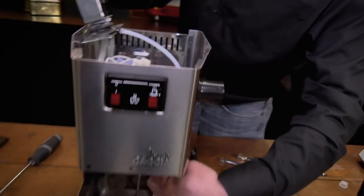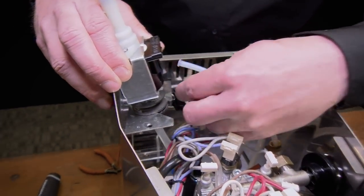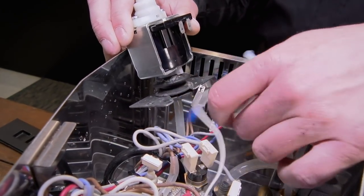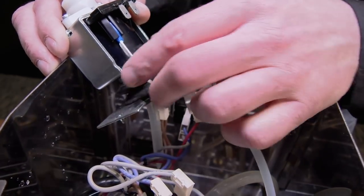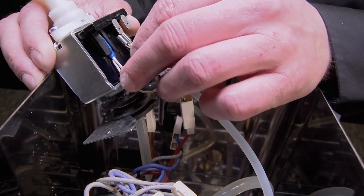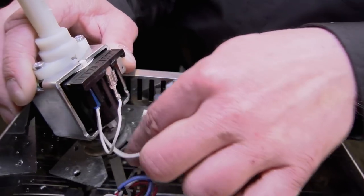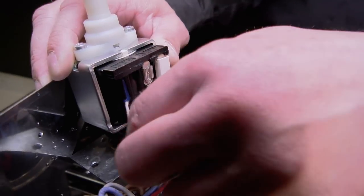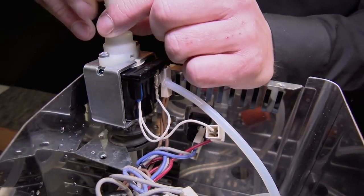Now we're going to pull the tubing down a little bit as we bring the pump down. We're going to hook our wires up — there's a little holder here with a slot that you can push the fuse back up into. You don't have to glue it; it never comes out anyway. Then take the wire on the same side as the fuse — the silver one without the cap, the little white wire — and push it on there. Then grab the other wire and push it onto that connector. The order of the wires does make a difference — the fuse is on this side, so always hook this wire up on the same side as the fuse. And then the other one goes on the other connector.